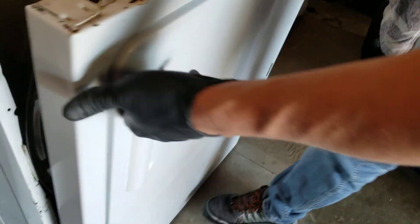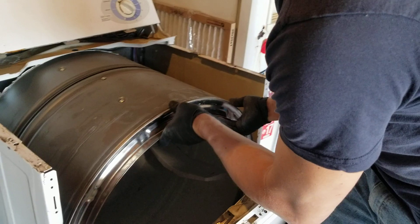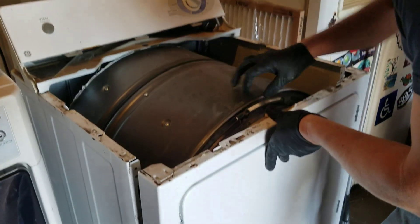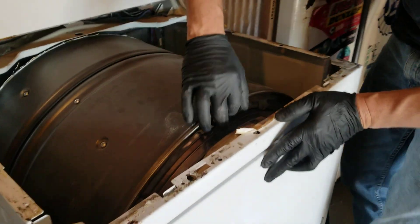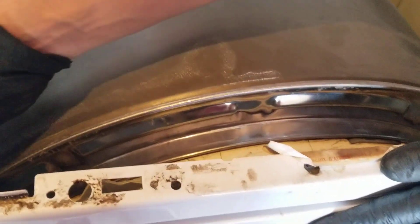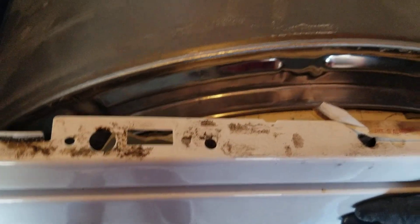Push it in, take the drum and push it all the way back — there's an idler pulley in the back that sits inside the center. Then put the shoe down, pick the drum up, push it in, and make sure you're tight and close on both sides and let the bottoms lock in.